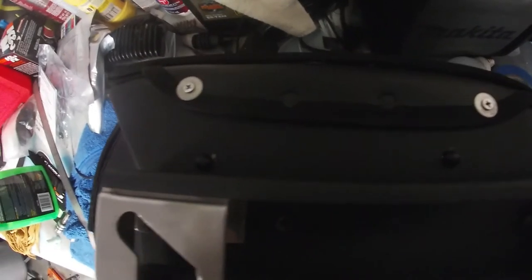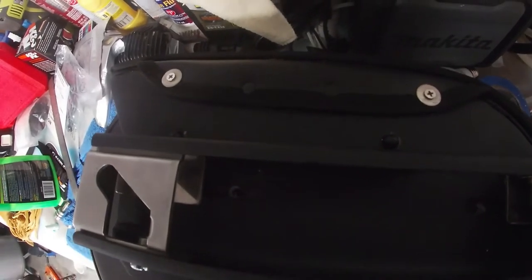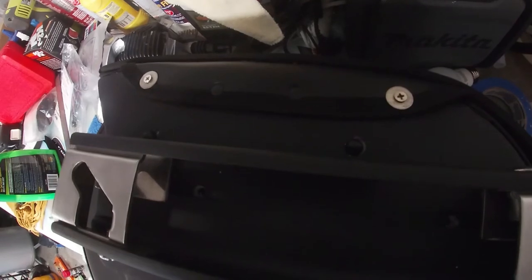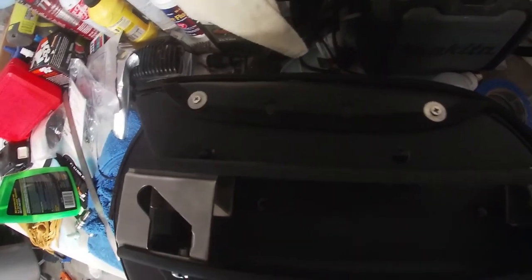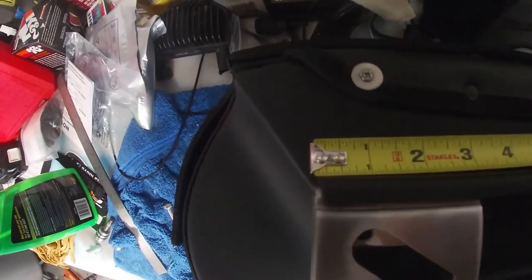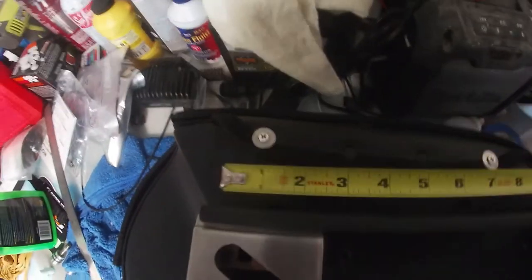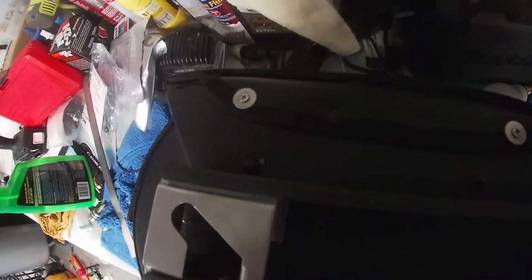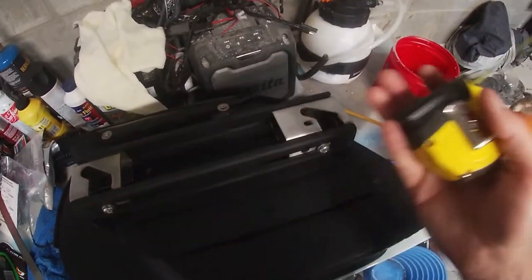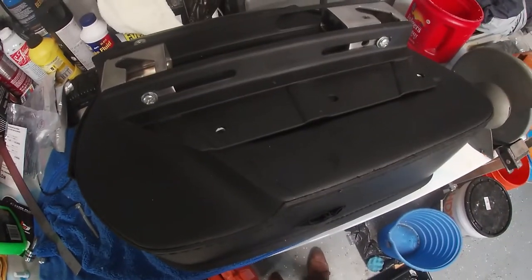And then, so these two that right now they have, those are the factory holes they put in there because it had a fender strap on there, and I don't particularly care for fender straps. To each their own. It would have made it a lot easier to use that, but it wasn't really the style I was going for. So what I did is I measured from the very edge of the black metal, not the stainless, the black metal, to the center of that factory hole. That gave me my side to side how I wanted it. And then these two points right here, fine-tuned those in, marked out my holes. Did that for both sides,